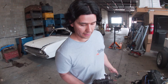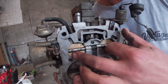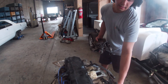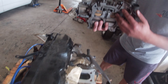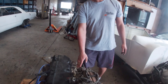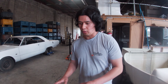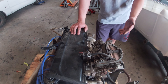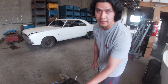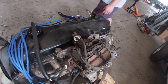Let's go with fuel to begin with, and possibly a bit more air. I've got an old Quadrajet in my hand — it's a four barrel, you can see there's two and two barrels. If you want to add diabolically more fuel, number one you need to change your manifold, because this four-barrel is not going to fit the stock two-barrel inlet. Let's say you stick that on with an upgraded manifold. The issue though is you may over-fuel it for the rest of the supporting mods on the motor — there's no point over-fueling it because you'll just waste fuel and won't actually get more power. So when you upgrade one thing, you've got to think about everything else.